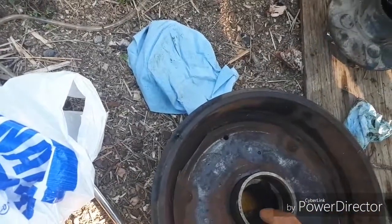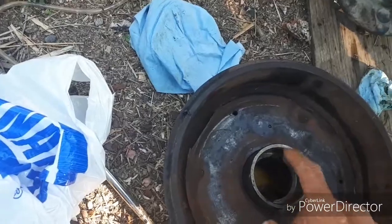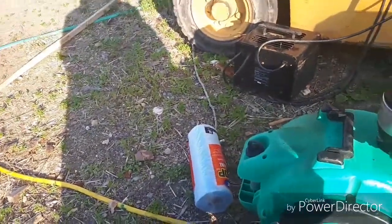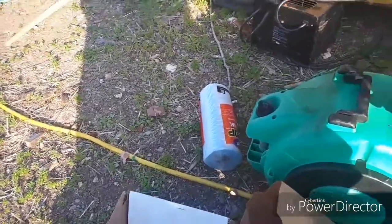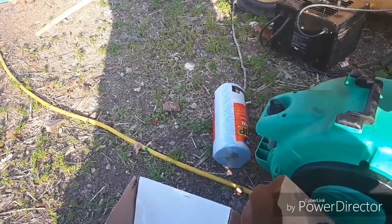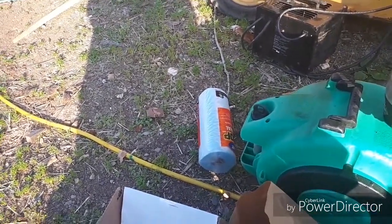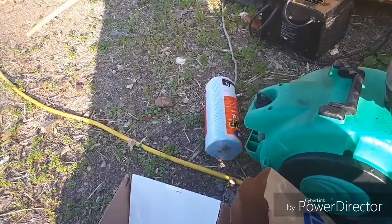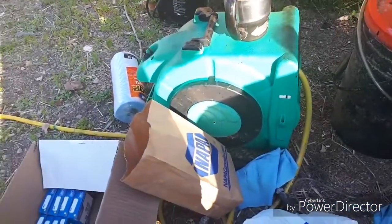So it's got a larger step ground into it, and then a smaller step machined into it, and they don't fit. And not only that, like I say, they're Chinese bearings. I don't know who they're made by because it doesn't say on any of the bearing kits. I have some of the bearing kits in stock for the 1,000 pound axles, the one inch spindles, because those ones don't carry much weight, so it's no big deal. But for these 3,500 pounds, you want something that's going to hold up. So I don't recommend buying the kits for the 3,500 pound axles like these are.